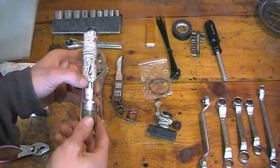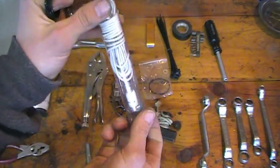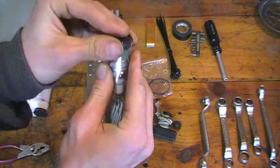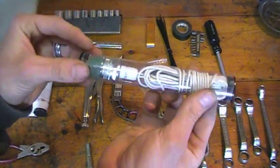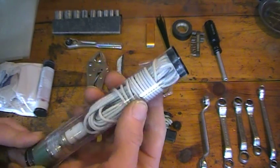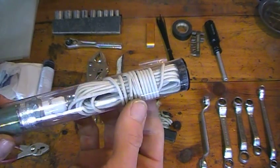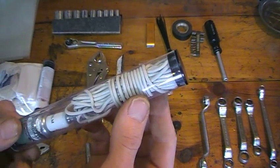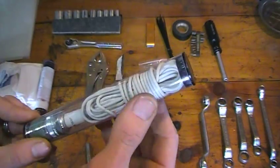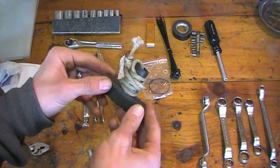This is just a little tube of spare parts. I've got an extra spark plug in there, and I made sure to put a small piece of vacuum hose onto the end of the spark plug so I don't screw up my gap — because that would be kind of pointless to put in a plug that was incorrectly gapped. I've also got about 12 feet of 14-gauge wire, which is very multi-purpose. You can rewire your entire lawnmower with that single piece of wire, tie things on, or wrap it around a hot falling muffler — the coating melts off but the wire stays.